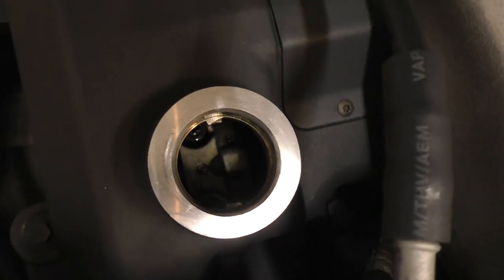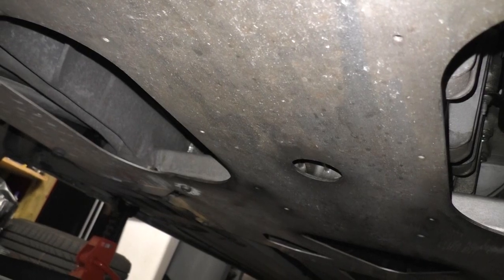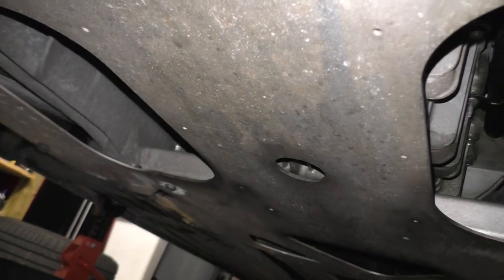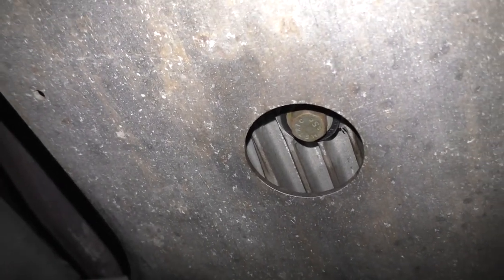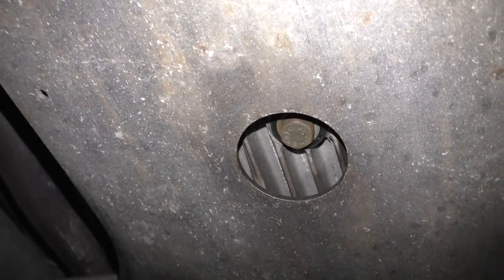This is going to allow a smooth pour of the oil as it drains out. Now we're underneath the car. In the second under tray, you have these two large holes on either side with the exhaust manifolds up there, and in the middle of them you have the drain plug hole. Because there's this hole right there, you don't have to actually remove the under tray. You'll need a 15 millimeter socket for this — just pop that out and the oil will flow.